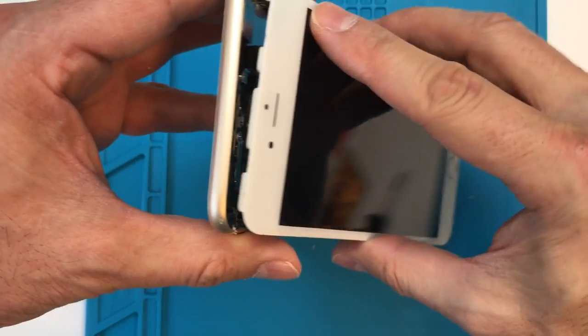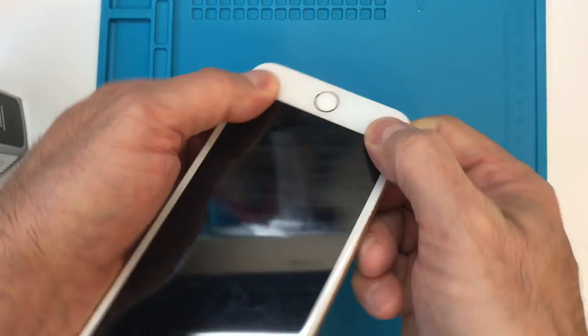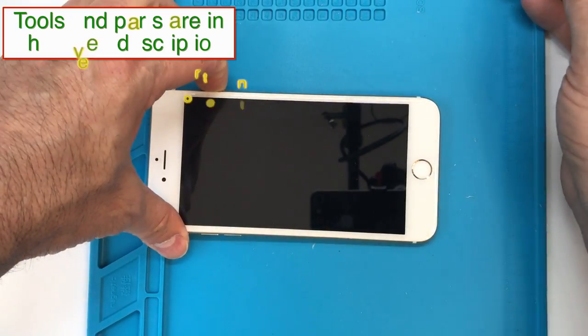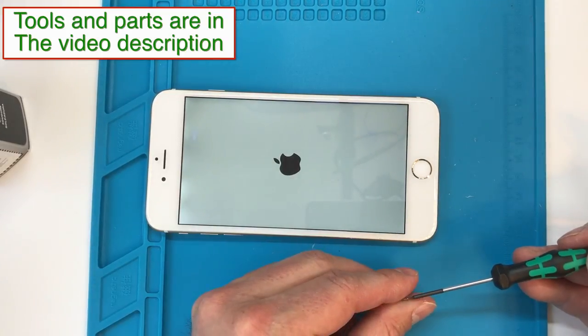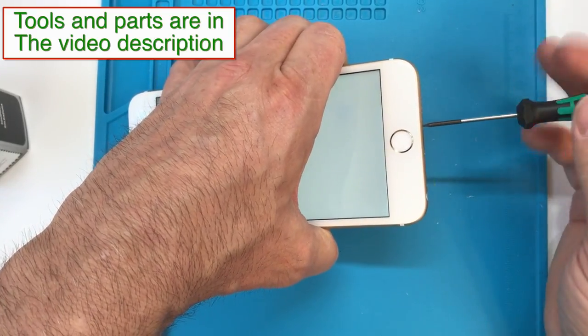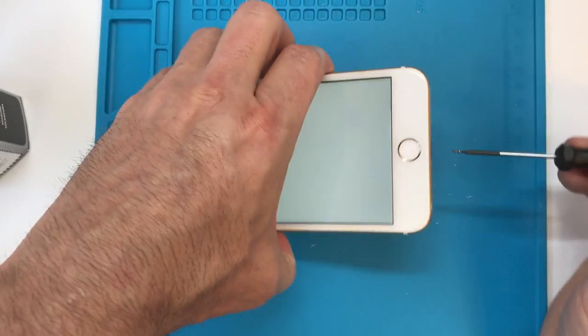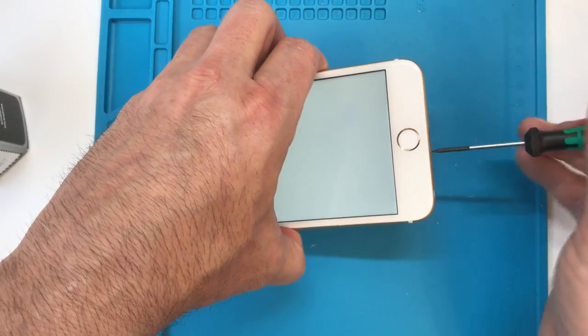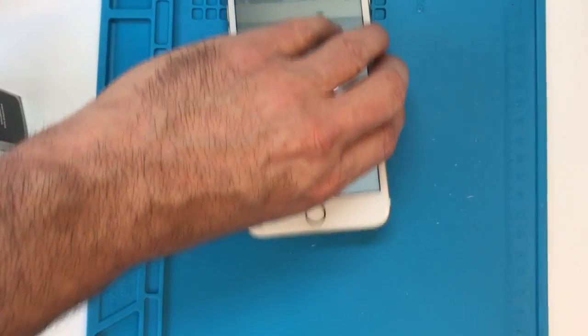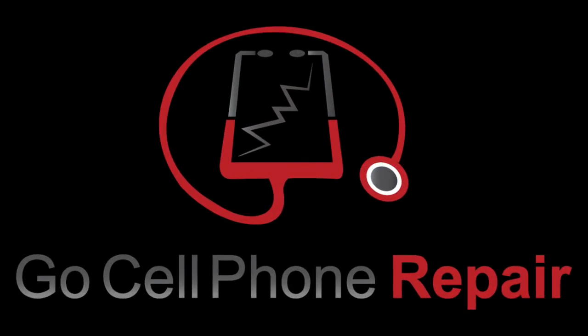Be sure to tuck in those tabs at the top of the screen underneath the edge of the frame, then just work your way gently along the sides and the phone should close up properly. I always like to see if I can race the boot-up on an iPhone as I put the pentalobe screws in the bottom — with an iPhone 6 Plus it's not too tough because this thing takes a while to turn on. If you found the video helpful, like it, share it, check out my channel for more tutorials and product reviews, and most of all remember to hit the subscribe button. Feel free to leave your feedback in the comments section — thanks for watching.